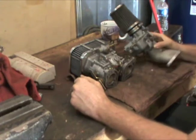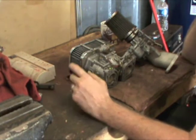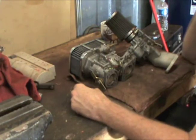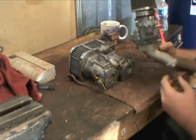I've seen this myself. When I was younger, I had a '72 Z28 with a Holley 650 on it — that's all I could afford. The motor was a 60-over 350, four-bolt main, not a big cam or anything like that. A buddy of mine had a 750 double pumper, and I put it on my motor — it came to life, seemed like it doubled the horsepower. That's the same thing: if you have a bigger motor and put a too-small carb on it, it's not going to get enough fuel to live up to its potential.